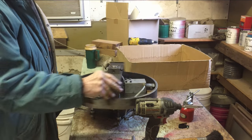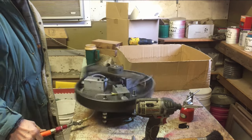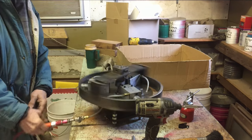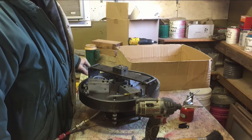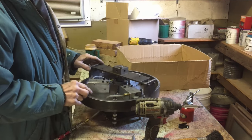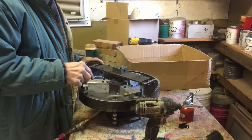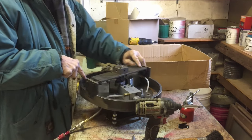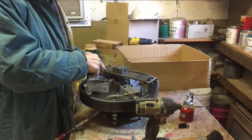It won't run backwards, but it can go backwards. I don't have a very big air compressor — it's just one of those little pancake things I'm using, so it comes on and off pretty quick. One thing I should mention: each cylinder fires two times for one complete revolution. On this position it fires one time, and on this one it fires again — so it fires two times for every revolution.